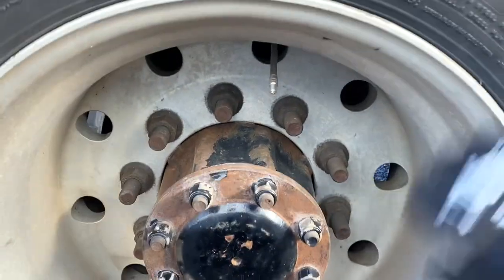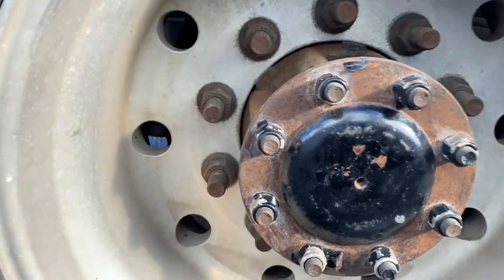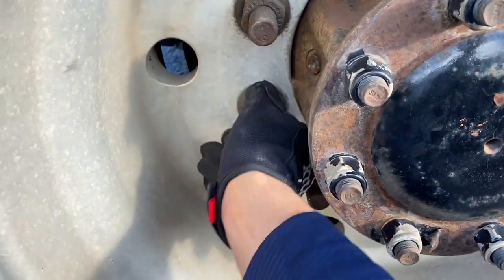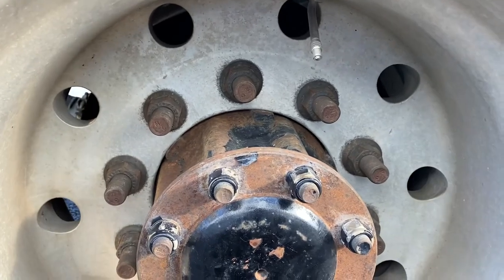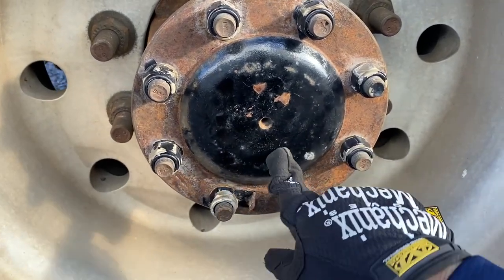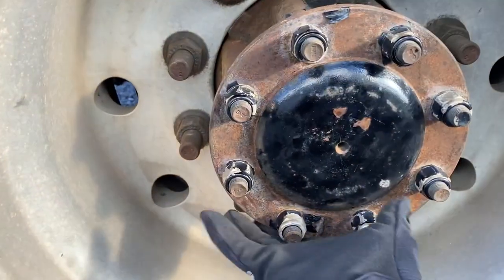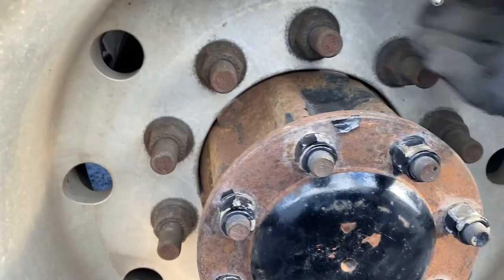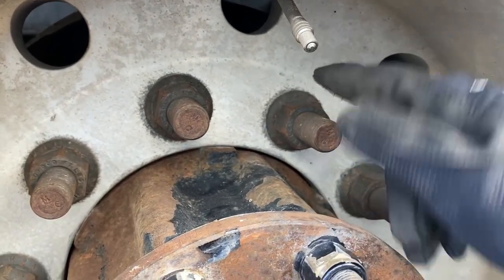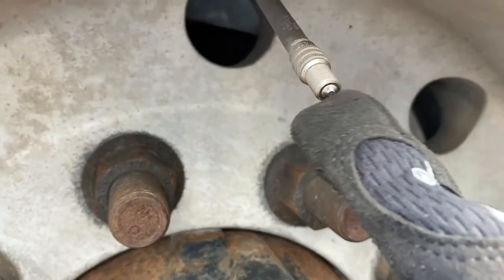Then I move on to the wheel again — on the back side, make sure it's not cracked, bent, or broken, no illegal welds on the wheel, all lug nuts are in place and tightly secured, no signs of rust trails signifying any lug nuts are loose. Then move on to the hub oil seal back here — mounted securely, all bolts are secure and not missing, no signs of any leak, not cracked, bent, or broken. The last thing is the valve stem — make sure it's not bent, properly secured. This one has the internal push button so it doesn't necessarily have to have an old school cap.